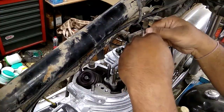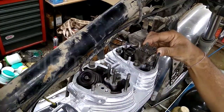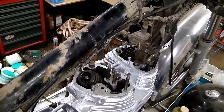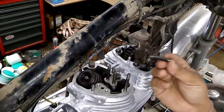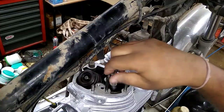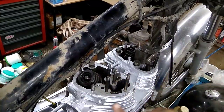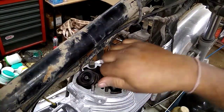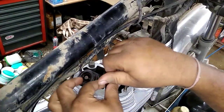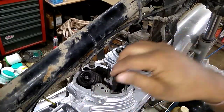The UC engine is completely different even though it also has a rocker box, as I mentioned in the introduction. As you can see, there is no play at all because the guide studs are holding up the rocker box tightly — it's quite a snug fit. The collar stopper side is going to be at the bottom, and of course you have to fix it up diagonally. It will stop — you can't tighten more than that. Don't use any stud tightening or removal tool at all; you can just do it by hand if the threads are clean and clear.